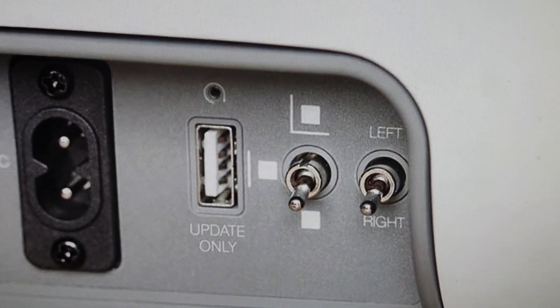You'll see the hub and the standby lights will start to blink. At that point, you can go ahead and unplug the speaker. And from there, it's reset — the reset is complete. You can go ahead and set this speaker up like a new speaker.